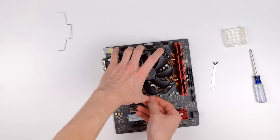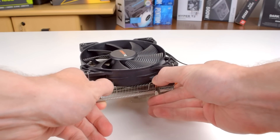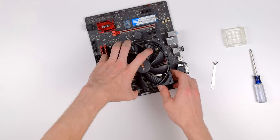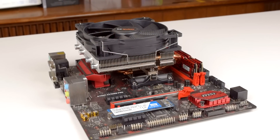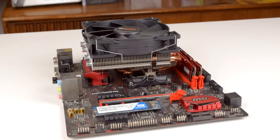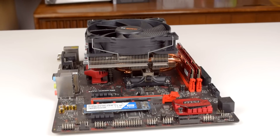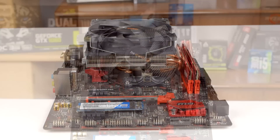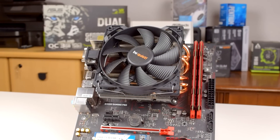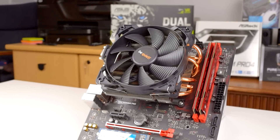The last step of installation is attaching the fan and plugging it in. The clips hook onto the front of the fan and then press into a channel on the side of the heatsink, pretty standard for most coolers these days. For most CPU coolers I recommend installing them outside the case, but for a low profile cooler like this it's pretty much required. Fortunately, it was a lot simpler than I expected, owing to BeQuiet's use of the existing AM4 backplate and latch. Once the cooler's installed, you can see it fits into a very tiny footprint — it's shorter than a standard graphics card and stays completely clear of the RAM slots, so clearance isn't an issue.